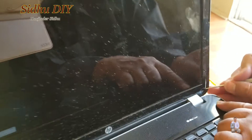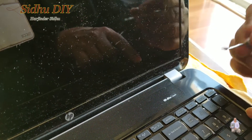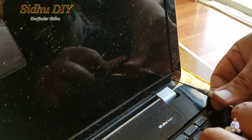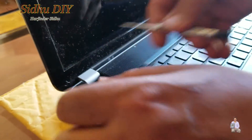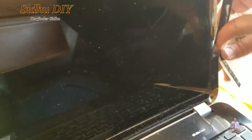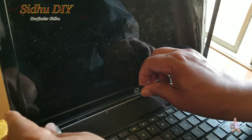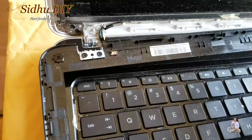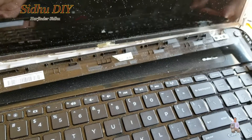On the corners, slide the screwdriver underneath. This one has a small tape on top of it — we're going to take that out, then you will see the screw and we'll remove it. Same thing on this side. Pop it open on all sides. The bezel comes out — just put your fingers up here and pop it open. These are the small tabs which were making noise, and from the side we are popping it out.